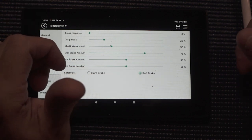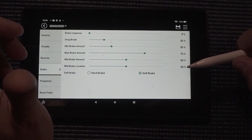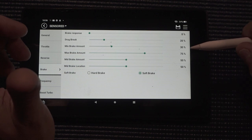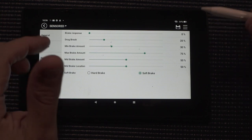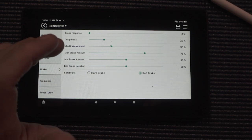If you do not adjust the max brake amount and leave it at 100, you are going to spin out when you tap your brakes — it's going to be super insane. Make sure you adjust that and give yourself plenty of run-out room, because you are going to be going faster than you ever have before. Just let off the trigger and let it cruise on out if you've got enough room. Don't worry about pumping the brakes.